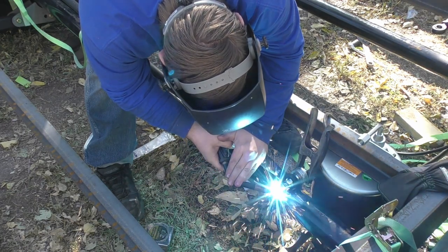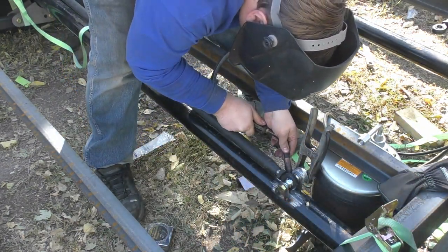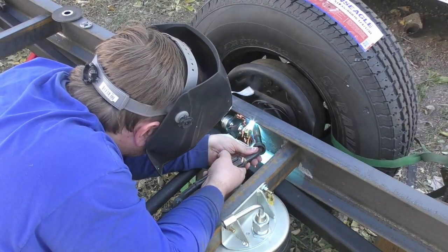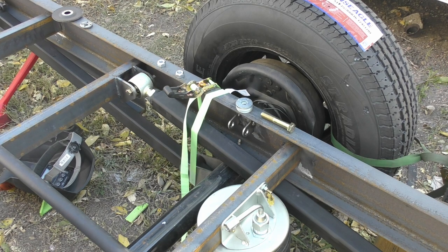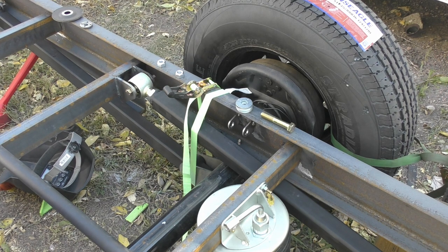There's still a lot of work to be done. I've got to yank out these axles, grind them down so we've got a place to mount the control arms and the spring bucket piece, but I think we're at a good stopping point for today because that's going to take quite some time. Hopefully next time we'll be able to get this thing actually lifting on some air and I'll finish weld some of these things. Thanks for stopping by and watching - hopefully we get to see you again later.